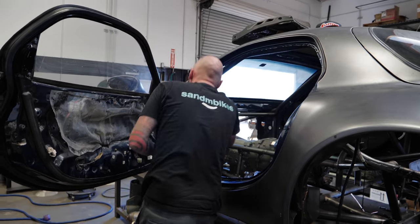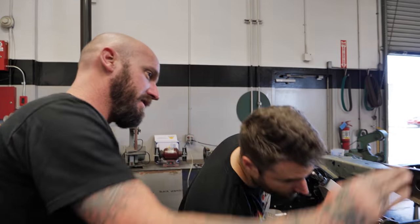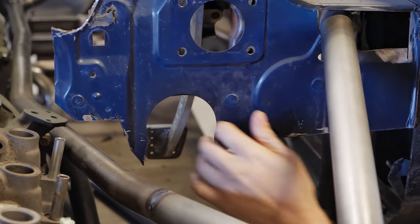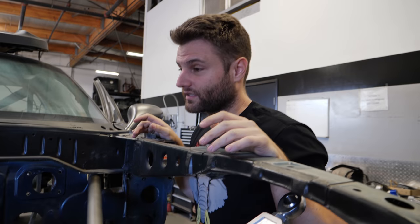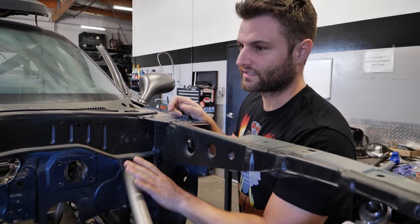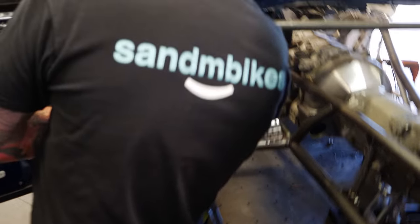Let's see if we can even use those. I think this thing's only bolted in at the top — we can pull that pedal out. Let's get that out and then I'll finish cutting that firewall too. I think the clutch reservoir is going to have to be remote; the bar on the far left side definitely gets in the way of that reservoir. You already determined you kind of like where that pedal is, just based on that when we cut the firewall out.